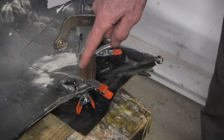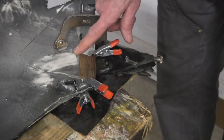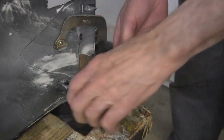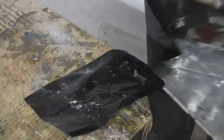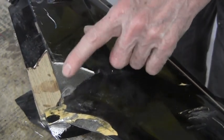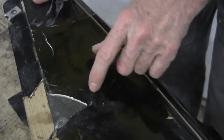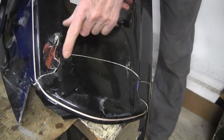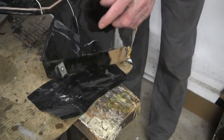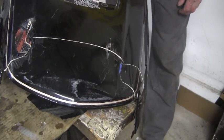This is the one that had the big missing part right in here, and there was also a missing piece over here. I took some two millimeter plywood and cut it out to fit, so it's got a part I'll have to glass over and then fill in with some fairing compound. Since there's so much glass work on here, I may cover the whole nose with glass and back out here. You can see where it's cracked up in here and over here and down the side, so I may just glass over the whole thing, sand it down, and paint it.